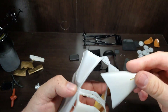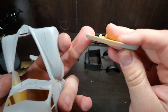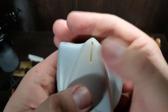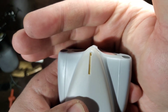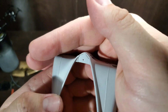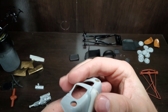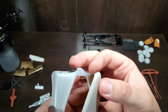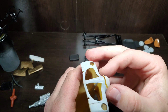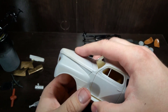The only other thing is the hood — it doesn't really have any good mounting points, just a couple of little tabs, so it's hard to find center and keep it in place. I decided to drill a hole under the hood ornament so I could hit this kind of latch pan here, and then I'll put in a pin later after it's painted. I want to get the drilling done before paint. That should remedy the situation and hopefully keep that hood in place.